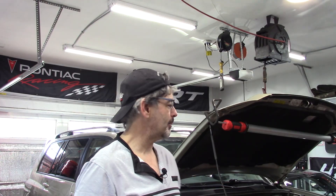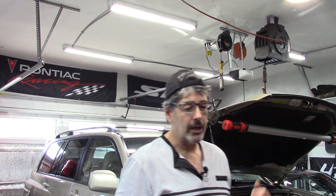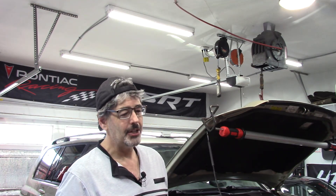In this video we're putting specialty tools into application on a Toyota Highlander. The background: this car came in with a P0325 knock sensor bank one code. Diagnosis confirmed the knock sensors work fine, but the wiring harness for knock sensor bank one has high resistance causing the code. The computer is good, the knock sensors are good, but we have to replace that wire harness underneath the lower intake manifold.